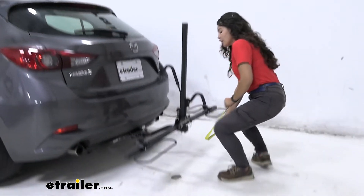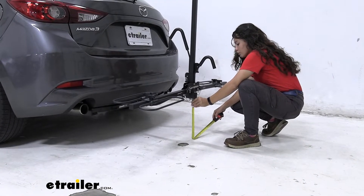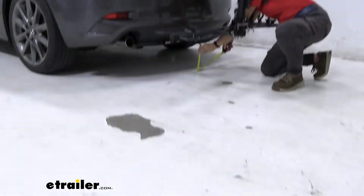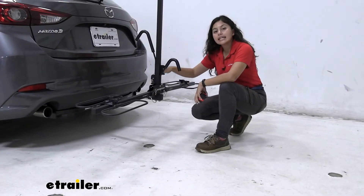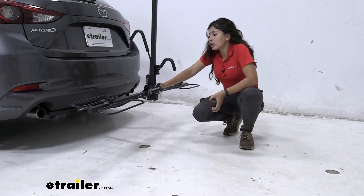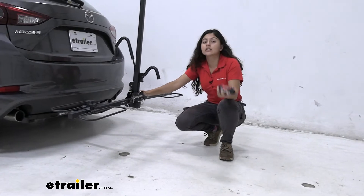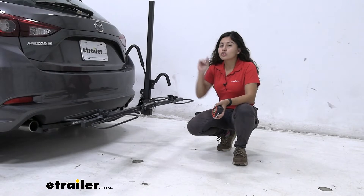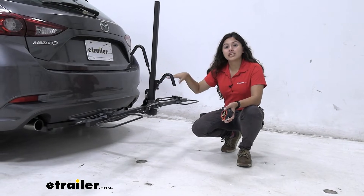Let's also take a look at ground clearance. At the center of the rack, below that to the ground, it's going to be 12 and a half inches. At the shank to the ground it's going to be 9 inches, so you do have that slight shank rise. That's helpful because this car's hitch sits a little bit closer to the ground compared to taller SUVs or trucks. You're going to appreciate that shank rise whenever you go up steep inclines like driveways or hills.